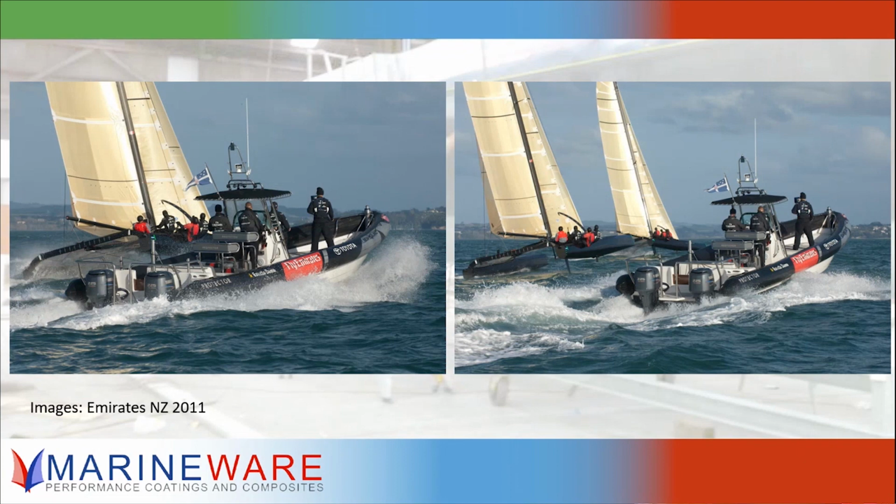You mentioned the haloing between the darker colours and the primer. I used to find about 5 to 10% clear in there in the darker colours used to help with that. Have you ever had that problem, Chris? Yeah, it's one of those problems that only ever really cropped up when you're trying to rush something. But having the clear, you could almost put a bit in like a blending solvent. It increased the resin a bit, which helped it not flatten out as much.